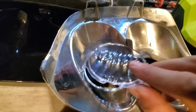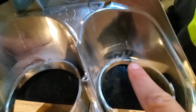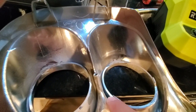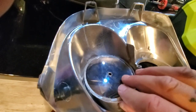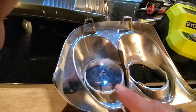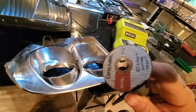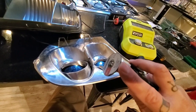We've basically popped off these lenses — they've got little clips that hold them on. I've cut that one and there's a little small bump that holds it in place, like a little stud. You want to make this a completely flat surface, so just cut this off, even all the way around. When you put the plexiglass on there — I use acrylic because acrylic cuts very easily — it will sit on there real flat with no gaps. I like using this kind of Dremel cutting blade. This is for metal but it also works on plastic. The reason I don't like the regular metal cutting blade is because the plastic melts to it and gums up, and you end up having to pick it off every few minutes. This blade the plastic won't stick to.